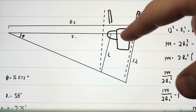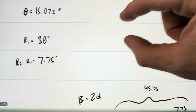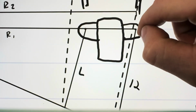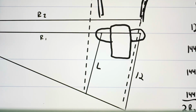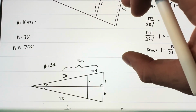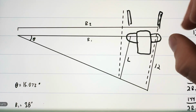This is the side profile of the beam. These are the two brackets, and here's the 7 3/4. I said 7.5, but that's what the distance between here is roughly. Now, it doesn't need to be too exact because the changes in these locations are not going to change how much that shock travels too much. For what I'm doing, it'll be fine to just get a close estimate.